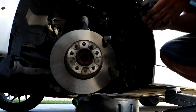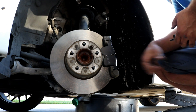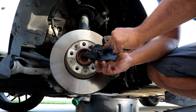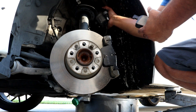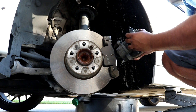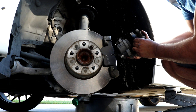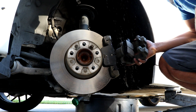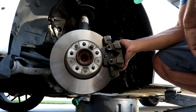The front pad you're going to need to slide right back to where it was. Then the rear pad — it has springs on it — you need to take it and push it back into the caliper so that you can slide everything back on together. Make sure you have it going the right direction, then push it right back into the caliper just like so, then go ahead and reinstall the caliper back into position.